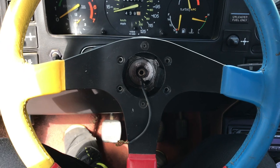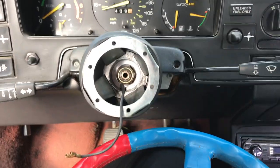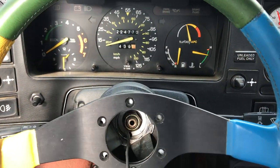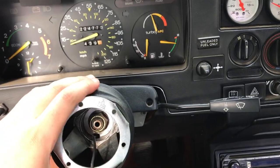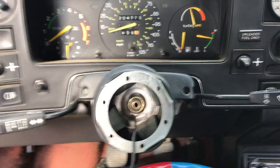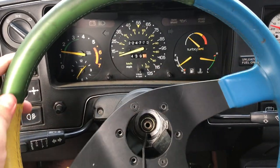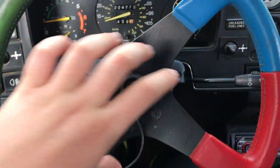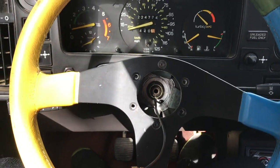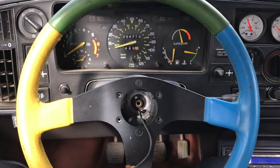What I'm going to do is put the bolt on, tighten it a bit, then take the wheel back off and tighten the bolt fully, because I need to do some work to get the horn working. To be honest, I made a mistake trying to tighten this without the steering wheel on, because when you tighten that bolt it turns the wheels and I lost my center alignment. So I bolted the steering wheel on quickly, took the car for a drive, found it was just about one notch off, and pivoted it to correct it. I was able to move it one notch over, which brought it to about dead center. I'm satisfied with that.